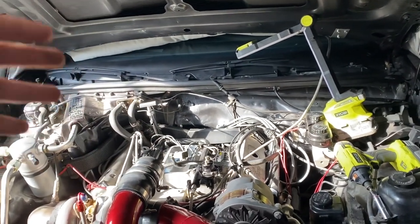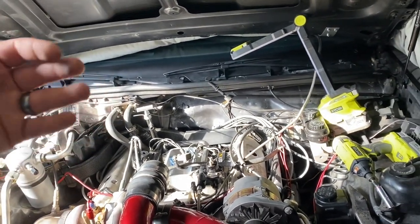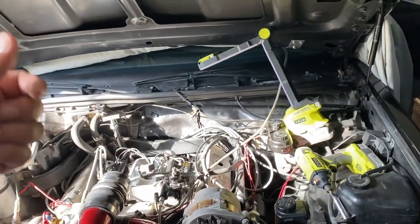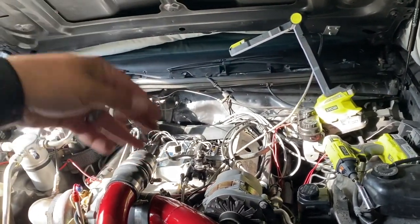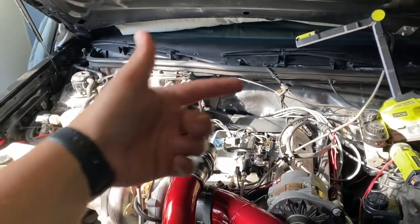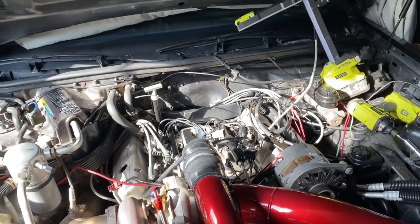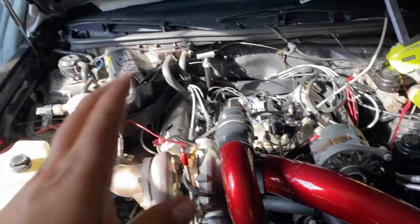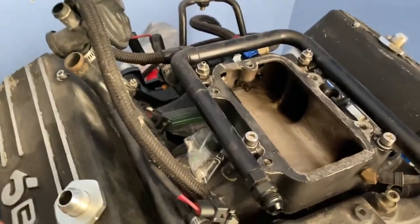Now I've removed all those parts and I have the space, so I can drill without removing the intake. On most other cars you're probably going to have to undo the loom for the wiring harness because it's bolted to the back of the intake — in this case it wasn't. I'll just pull an old bolt, put it on there once I'm done, and shove everything in the back. Get your right-angle drill, drill the holes, and you don't have to run those hard lines that most of the time are cracked at the welds.